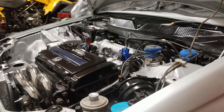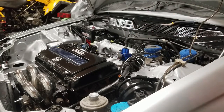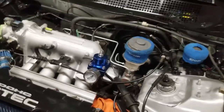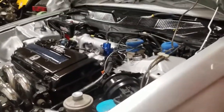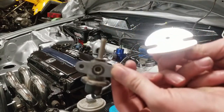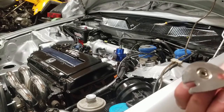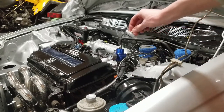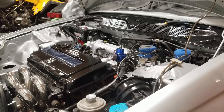So we got the regulator in — basically just took out the old one, cut the pressure line to shorten it a little bit to hold it onto the manifold, then inserted it into the return line, and that's holding it in a pretty good spot. Now next is the actual fuel feed. The kit I got was universal, so these lines here need to be straight across just like the stock fuel regulator, or else this doesn't line up and doesn't bolt up. So we're gonna trim this, drill some holes, and make it fit so we can just put that on, take the O-ring, put it in here, use that portion as our feed, then run the hose to the back, and that will be installed.